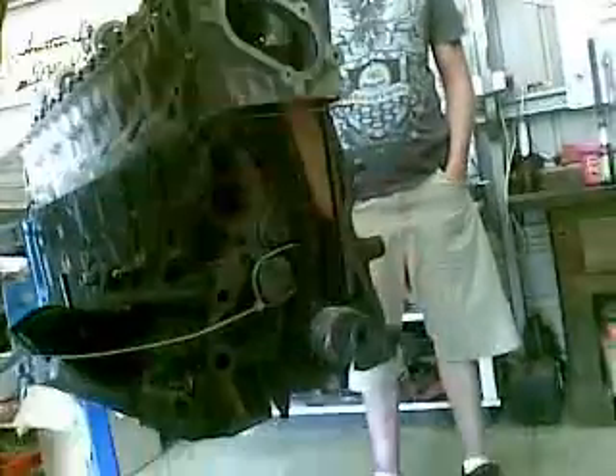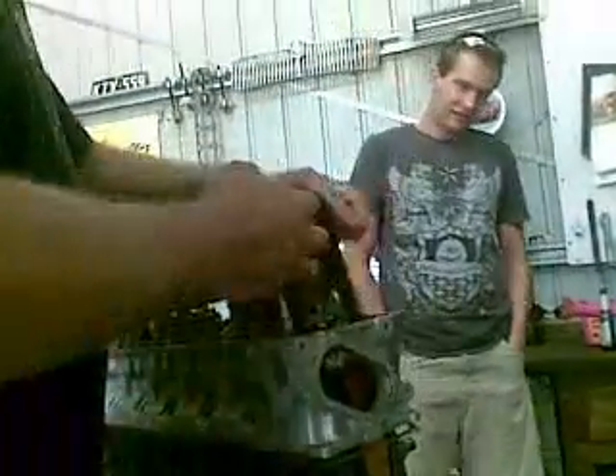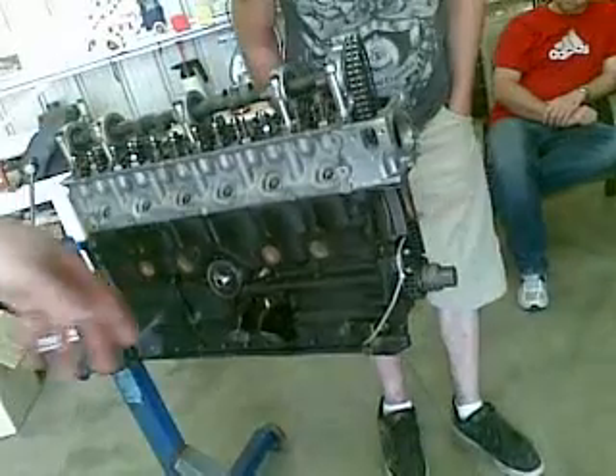Just in case you guys want to know at home — you can put the wedge in. Usually the hole at the top has a bit of wire on it so you can pull it back out. That's the key thing. If you wedge it in there nice and tight like that, it's easy to use. Try to make sure this side's tight, because that's the tight side — this is the loose side of your chain. So when we go to put the top in, which we'll do now, you can pull the cable tie out of the way and the wedge will hold it all anyway.